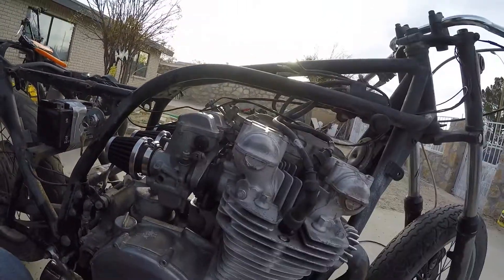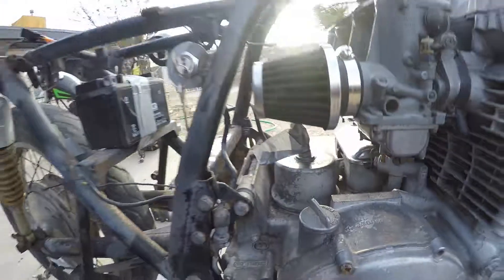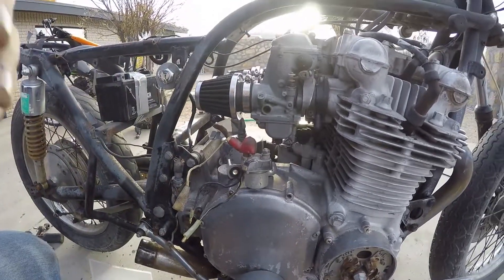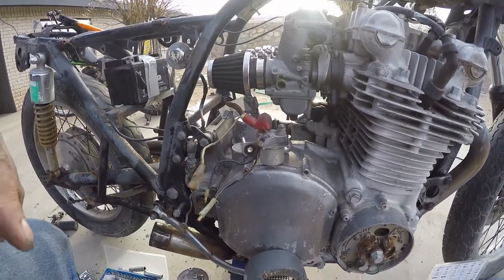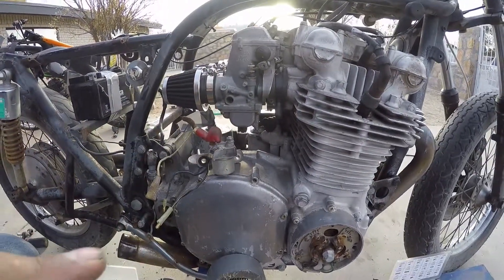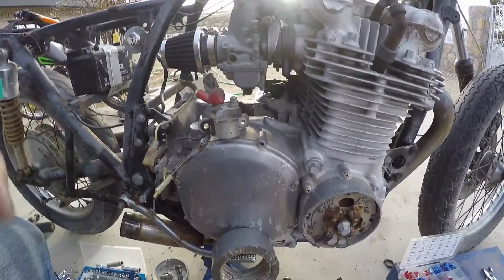All we need to wire in after that is the starter relay. Most motorcycles — the starter is a chain drive and there's a clutch. The starter is always connected to the crankshaft, but that clutch slips when the engine starts and it grabs when the engine is dead. So there's no solenoid that bumps the pinion gear into the flywheel. It's a one-way clutch — pretty simple.